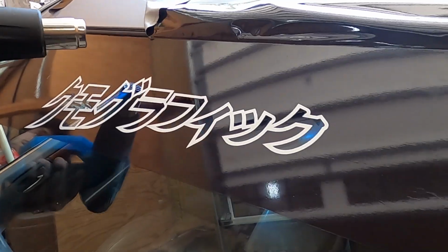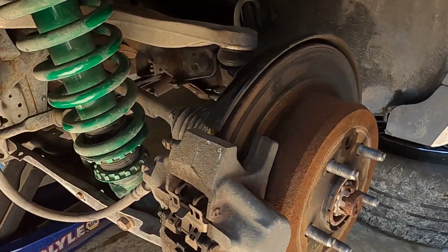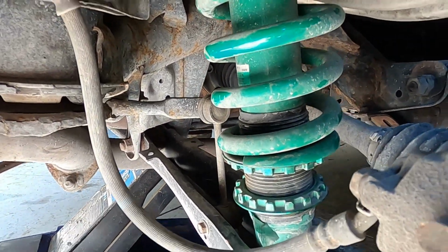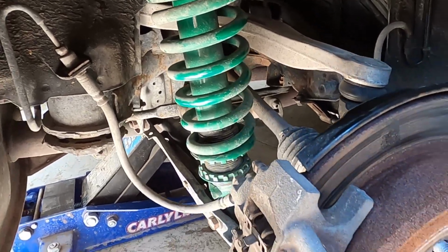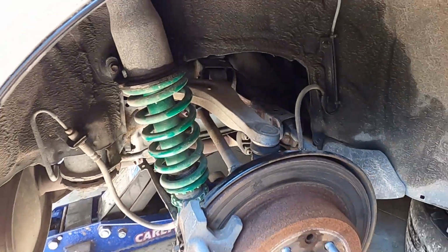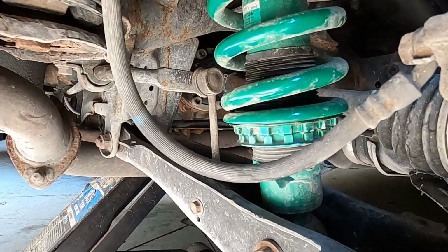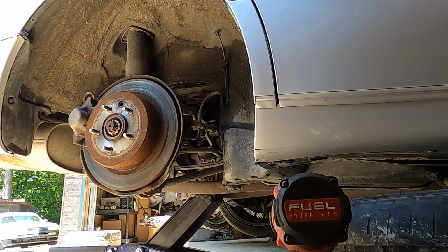Also installing the fresh Spider Graphics Jet brow. Lowering the rear, give her a little bit of Cali lean. It's already got these Rev 9 coilovers on it, which is great. Best thing we never knew we were actually buying. So we'll dump this thing. These coilovers are only preload adjustment to adjust ride height. That's fine. We'll get her fixed up. Ride height is set. So now we'll get the wheels on.